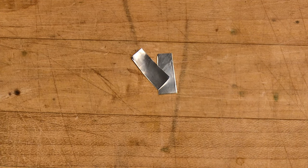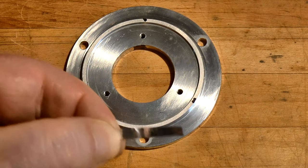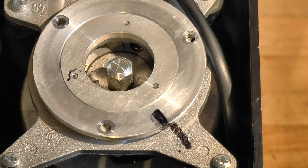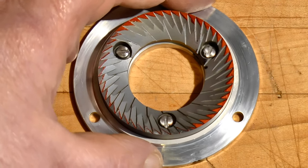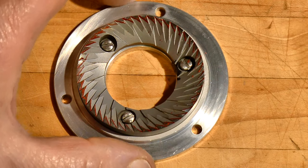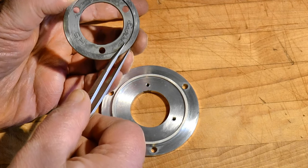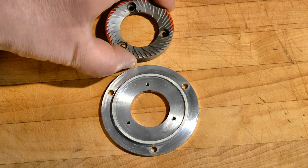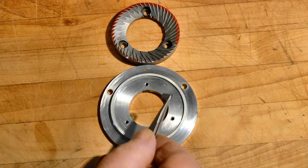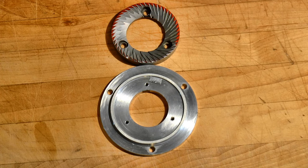I'll adjust this with shims made from aluminum foil — I simply fold them to make them thicker as needed. You can use shims in one of two locations: either between the burr and its carrier, or between the carrier and the motor mount assembly. Each has its advantages and disadvantages, so I'll demonstrate both. First, let's shim the burr. Remove it from its carrier. Take care with the slotted screws — they mangle easily, but they're relatively hard to over-torque, so they're safer than Phillips, Torx, or hex. The smooth side of the burr has a narrow machined area around the edge that lies on the carrier surface — that's where the shims go. Notice that the area needing to be shimmed is at 12 o'clock when the black orientation marks are aligned. The midpoint of that area corresponds to a single screw location, so I'll use two shims, one on either side of the screw hole near the outside edge.